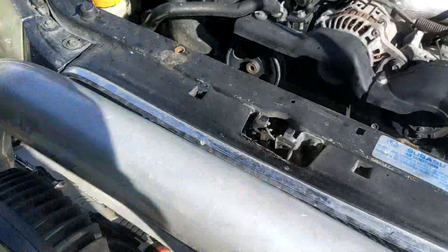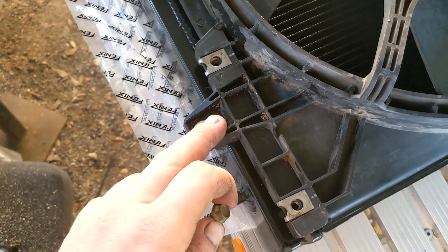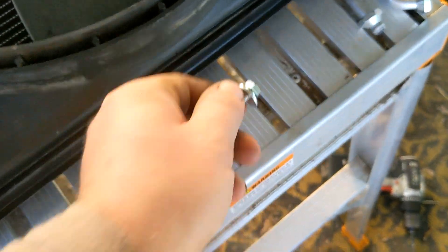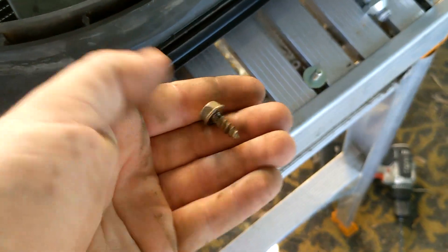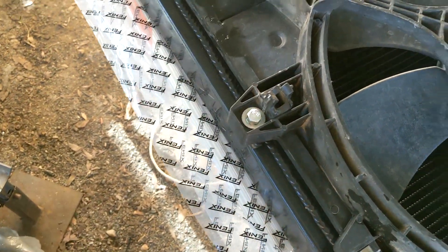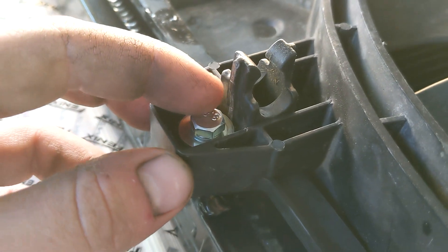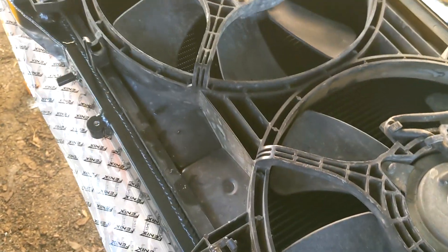Just gotta take that shroud off — unplugged it obviously. Get the new one out and show you. Found the shroud all fits on. The only thing is the bolts supplied are like a normal M6, where the original ones are like a screw-install type, so I just had to enlarge the holes slightly to fit the new posts. On these two here I just had to trim that bit of plastic back because the washer was fouling on it. Other than that, it fits pretty good on the original mounting points.